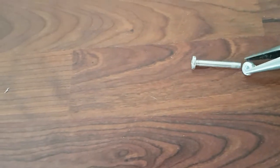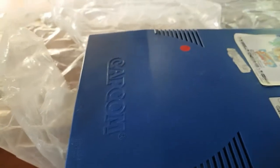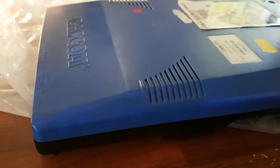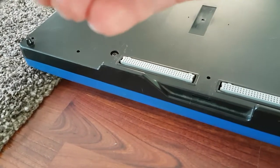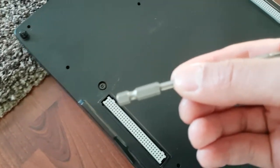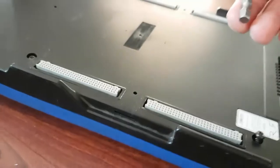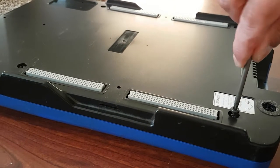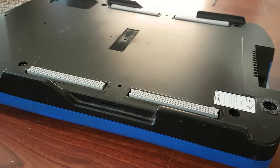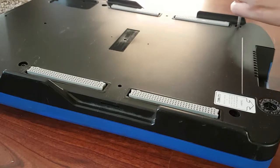So if you wanted to get in and perform maintenance on the game board, or remove the battery — which is what we're doing in this case — you'd have to send it off to Capcom. They would replace the battery for you and charge you a nice fee for doing that. I'm showing you here the security screw bit to get these other security screws off. Fortunately you don't have to drill these, but you do have to use the correct screwdriver bit to get them off.